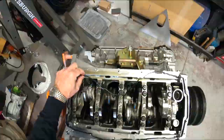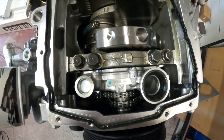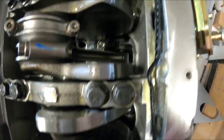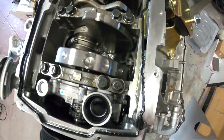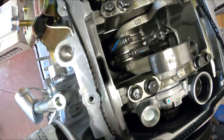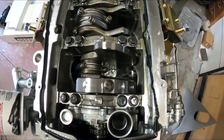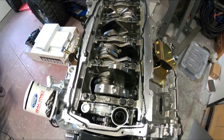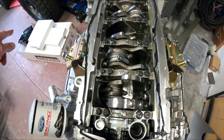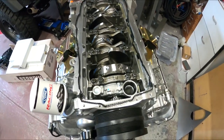You are now looking inside of a 5.0 Coyote Gen 3 motor - looks pretty impressive. You see the rods? Those aren't the powdered forged rods - these are actually the H-beam. You've got six main bolts, two here, one splayed on the side - it's a pretty stout bottom end. They say these motors will take 700-800 horsepower all day long with no issues. My big issue is this oil pan gasket is not going to work on that - so do I just Permatex this whole thing? I don't know. That's one thing I'm going to have to look into.